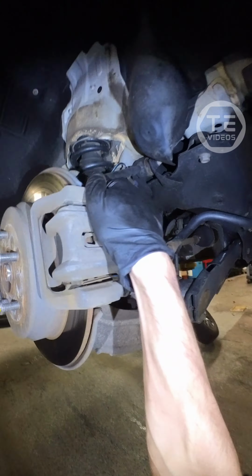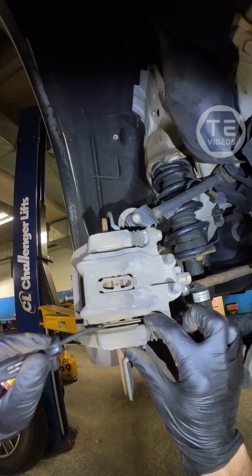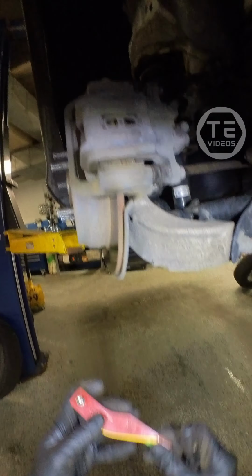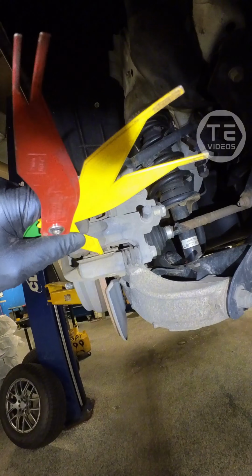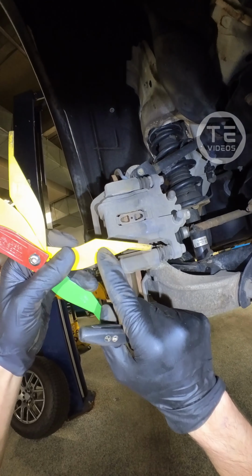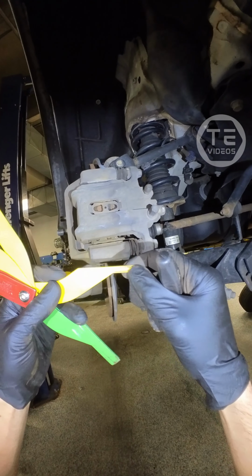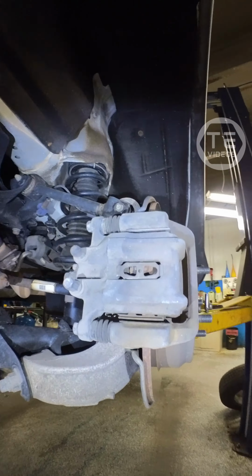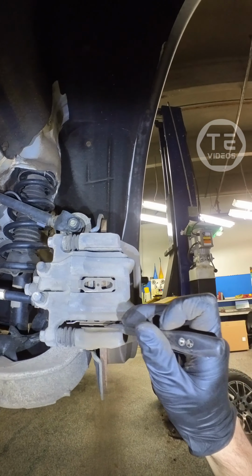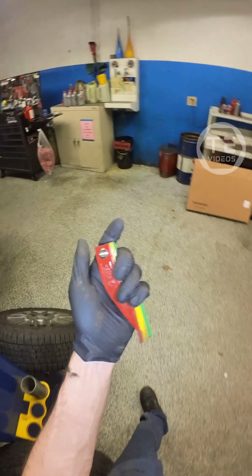The rears are looking much better, other than this bracket. Straighten you out, bud. That's a 6. So the inner pad measuring 6. I want to take 2 millimeters off there, since the squeak sensor sits 2 millimeters out. So that's 4 millimeters to the sensor, bud. That is just fine. This bracket is looking a lot better. 4 millis. So the rears are good.